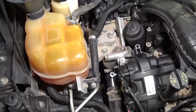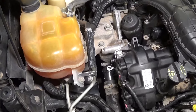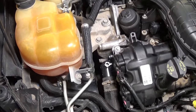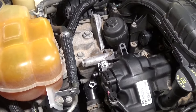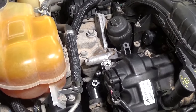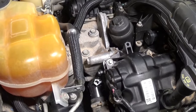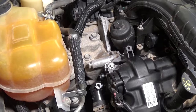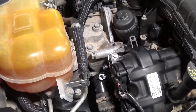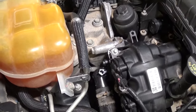Make sure that coolant starts coming out of the bleeder. You'll need to put a container underneath to catch the coolant that leaks out so you don't make a mess under the engine. When you stop seeing air bubbles for about a minute while slowly adding coolant, go ahead and put the screw back in — that's how we usually do it.